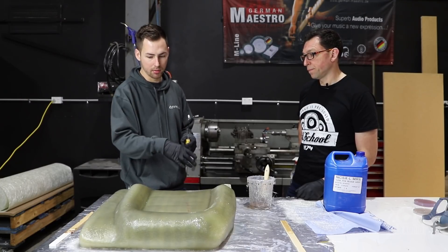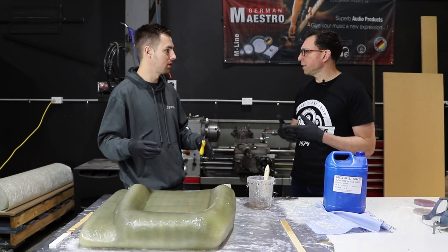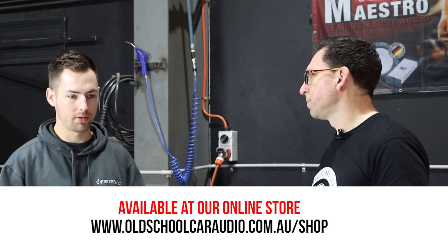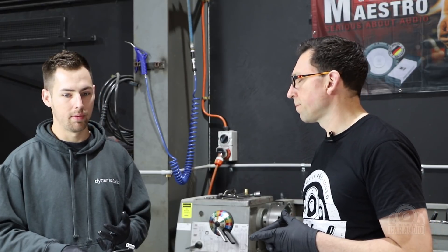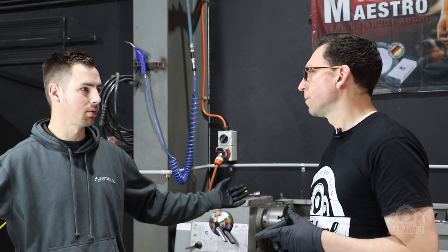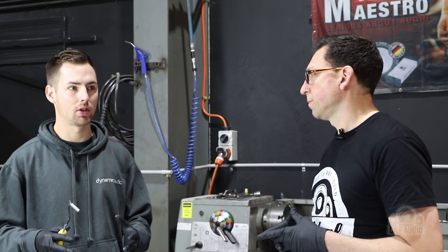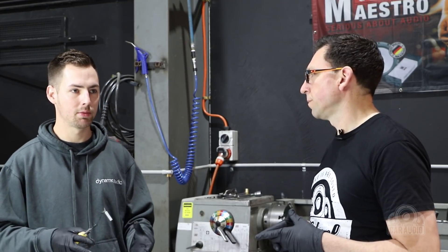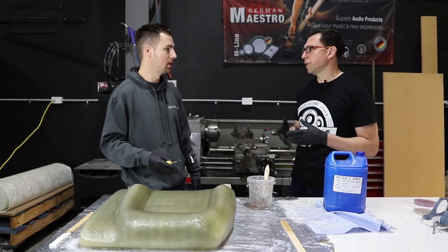In the lower section where the original seat was, you'll see the new Helix C-Series amps — the new C4s. I'm actually going to use them for all of the front stage and also the sub stage as well. There are a few benefits to that: it means your phase response is the same from your tweeter all the way through the sub, and everything is Class AB with the same sonic signature. You can get decent results mixing and matching amps, but it's really nice to have the same all the way through because every amp sounds different. And it's made in Germany.